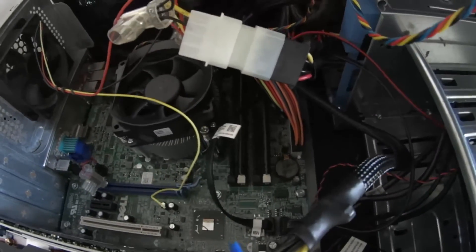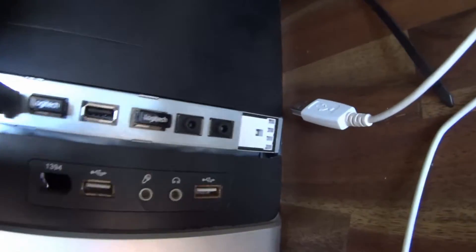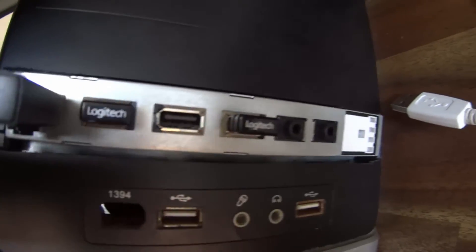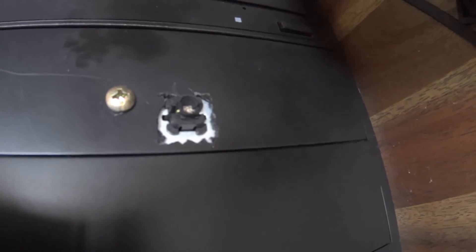The only other thing of note when I changed the Dell motherboard was to keep all the external peripheral devices as they are. So the fan is still there — that's the one from the Optiplex box. The peripheral devices like the ports at the front are the ones from the Optiplex box — the USB ports. The old tower ones aren't being used anymore; I've only wired up the new ones, the Dell ones. I also had to do some modifications here — this is the power switch from the Optiplex box. I made a hole in the front of the tower, stuck the switch through that, and that's what's used to switch the computer on and off now.